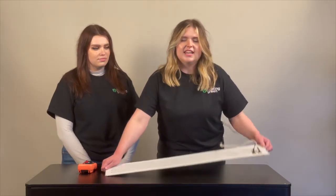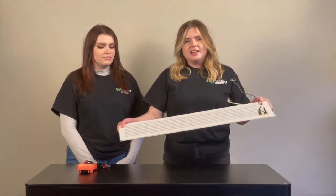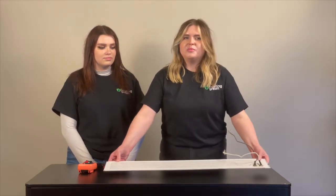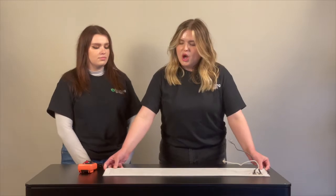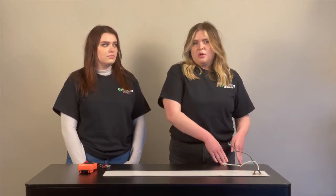This is what the element looks like in your heater, and this is the most important part. Basically, this element here is like a light bulb that goes inside the lamp. The ohm test tells us if the element is bad — the light bulb — or if there's something else on the wiring that needs to be changed. An open loop reading will let us know that your element needs to be changed, and then your heater will work again.